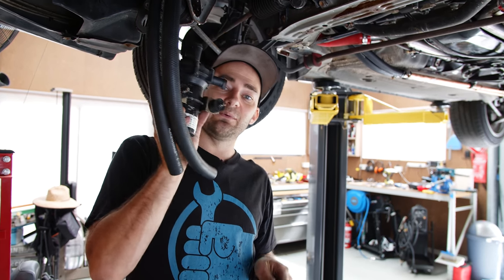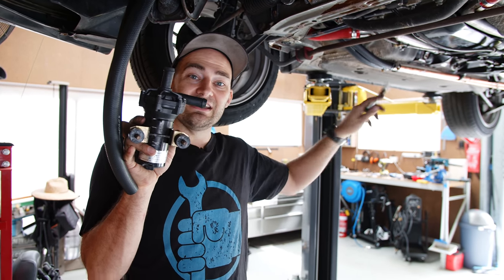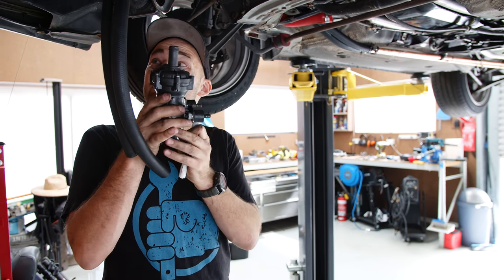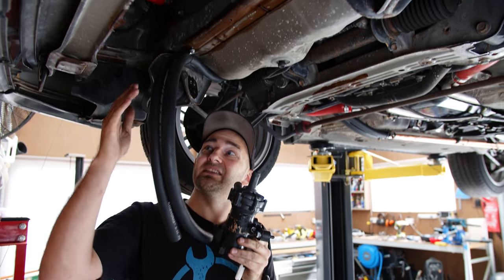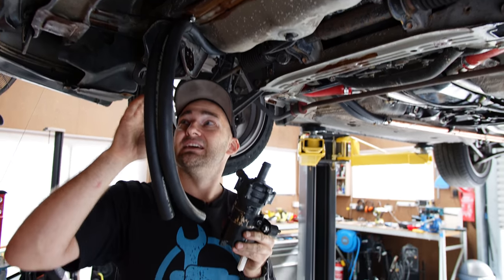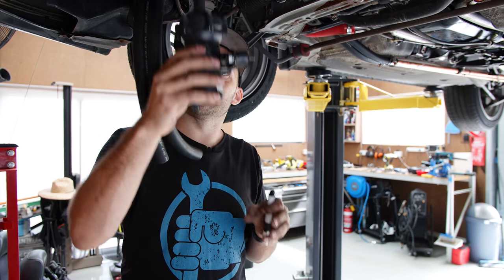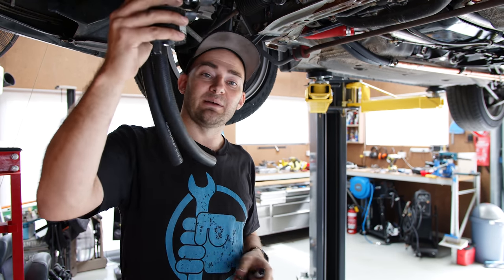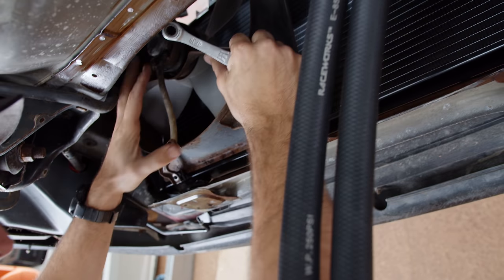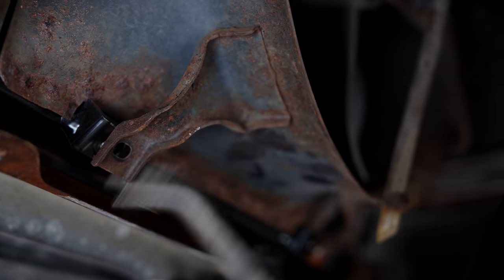You can't go to the shops and ask for MR2 water-to-air intercooler line clips, so I'm going to have to come up with something a bit better. For now it's in place and that's good. The next thing I need to do is work out where the pump's going to go. This is what makes the whole system work by pushing the cold water up into the heat exchanger at the engine — the hot water at the front cycles it all around. There's a good spot for it behind the radiator. I need to try and see if I can get the heat exchanger for the front of the car in front of the radiator. The radiator fans require a little bit of trimming to sit against the aftermarket radiator, and I need them in place so I know how much clearance I have for the pump, lines and associated hardware.